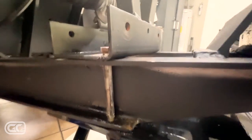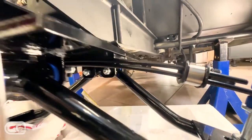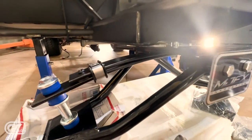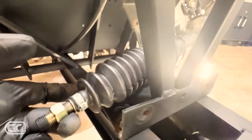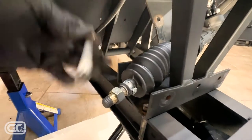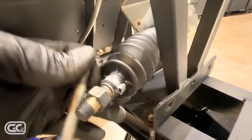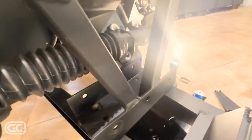Get the frame bolt started, then move to the back. This thing's not super heavy but it's a little cumbersome — I can see why the official corporate video uses a jack. I noticed that whoever had this cart before me put the lower spring shackle bolt up from the bottom, so I had to loosen up my rack and pinion to drop these long bolts down into the frame. The rack and pinion boot was in line with the bolt hole. I had to undo it on both sides.